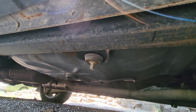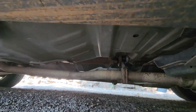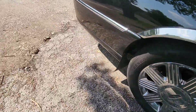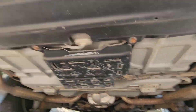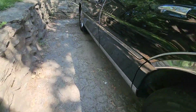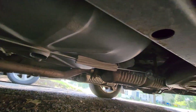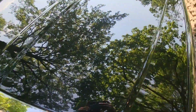You also want to look up underneath the car as best you can. You're checking: is the muffler there? Is there a lot of rust? Is the catalytic converter missing? Are there any sections that are really crunched in from being improperly jacked up? If you don't want to get on your hands and knees, you can just film a quick video underneath the vehicle. I've taken pretty good care of this one, so I don't expect too many issues, but you're basically going around looking for any problems.